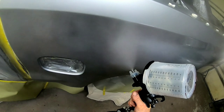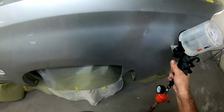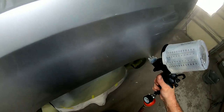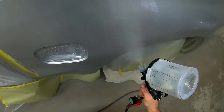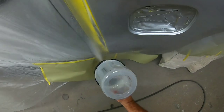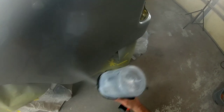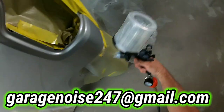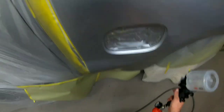As far as technique for spraying clear: overlap 70% on your passes and be four to five inches away from the panel. It's important, especially if you're starting out, to practice maintaining a consistent distance from the panel at all times — going around those contours at the same distance. This will help your clear coat lay down uniformly. I'm putting on the second coat of clear now, slowing down just a little bit, paying attention to how the clear coat is laying down. I'm using a light source to take a good look and make sure it's flowing out the way I want. For more detailed instruction on how to lay clear, check out the video linked at the end. Share your project with me at garagenoise247@gmail.com, or leave questions in the comments below. Thanks for watching — we'll see you next time on Garage Noise.